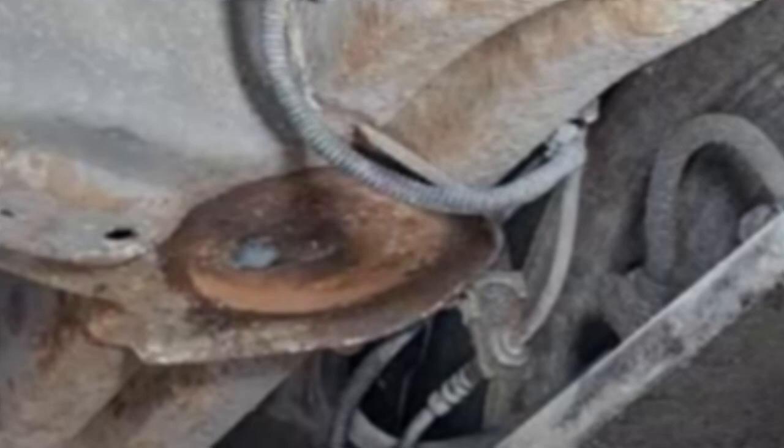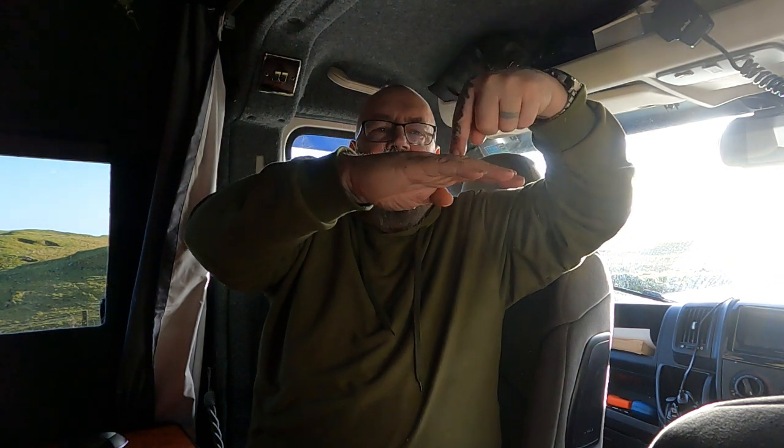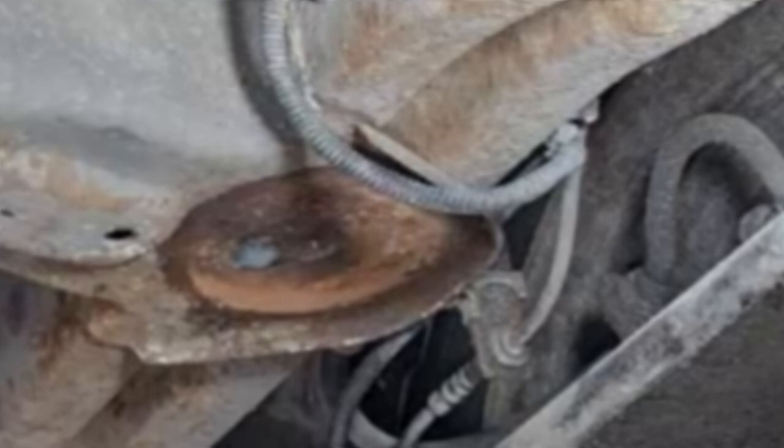Basically, the chassis rail that goes down the back legs on the chassis, they're like an inverted U. And then these plates that what are called bump stops mount to are welded across. So imagine you've got the inverted U like that, and the plates are welded like that. Inside there, there's a welded nut, or threads of just some description. Probably, knowing the way the other bit was, it wasn't even a nut, it'll have been a threaded bar. Anyways, that had come loose on the inside of the chassis.